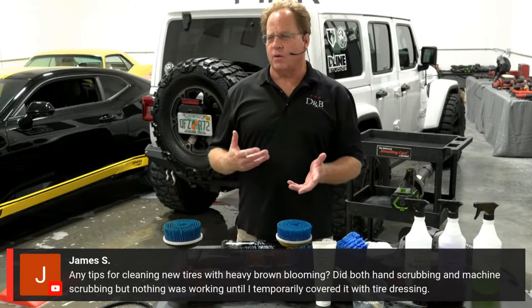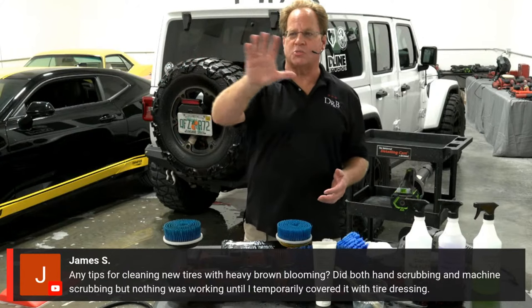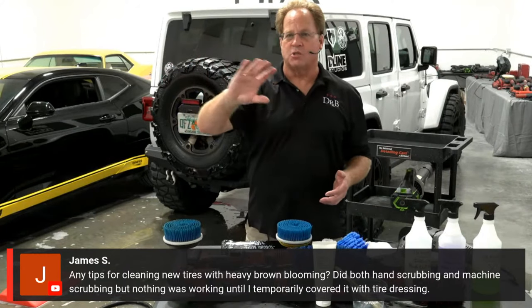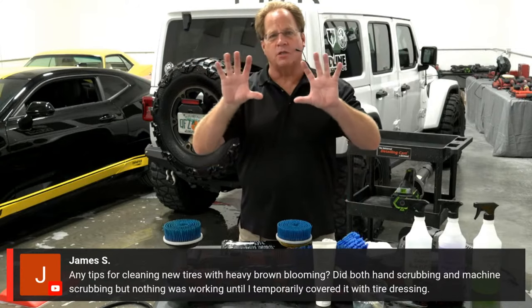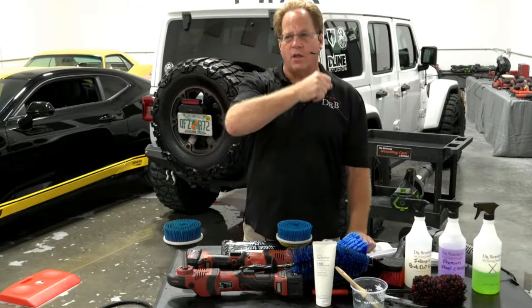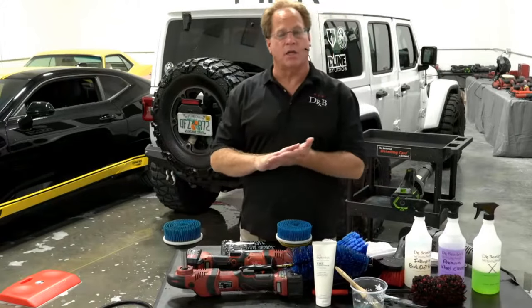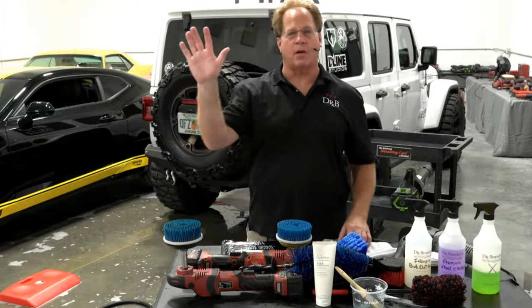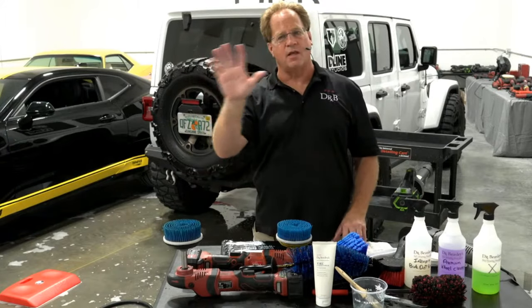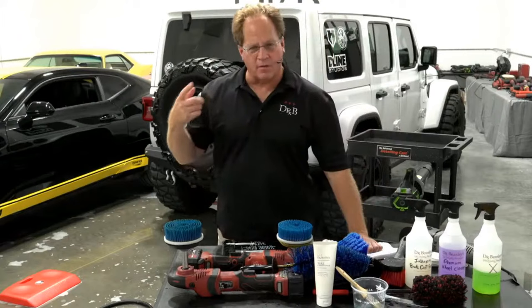It's the same thing like when I teach people how to polish the inside of a glass window. A lot of times you get a smoker's vinyl fog. Smoker's film or vinyl fog or just years of gunge in there, and you spray Windex in there and it just mixes with it and adds to it. You take a physical polish like our NSP GL glass polish, and just by hand with a microfiber applicator, go in there and you can actually abrade that film off, wipe the film off, then use the glass cleaner. But the same kind of theory.